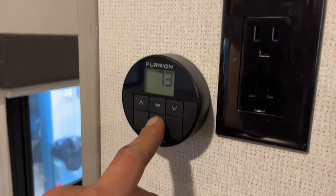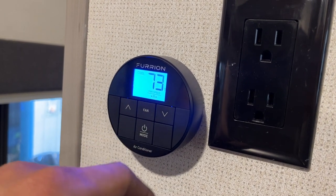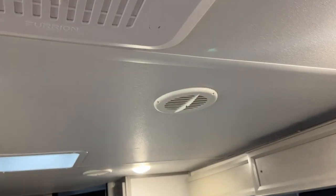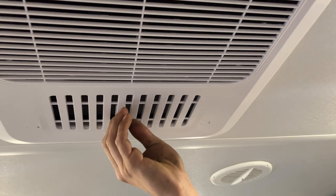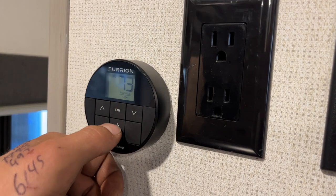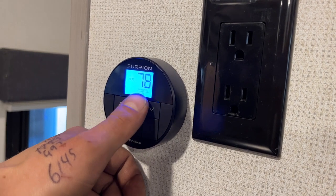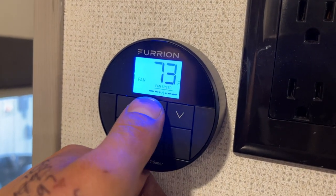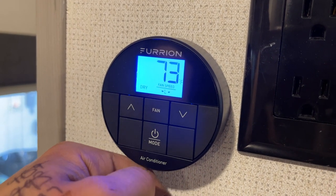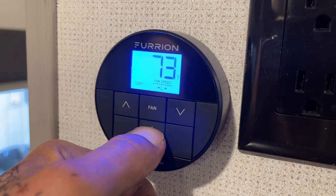On the left side you've got your thermostat — the power button turns it on. Cool mode first turns on the air conditioner; select your fan speed — low, high, or auto — and use the arrows for temperature selection. With the air conditioner going, you have two options: keep this louver closed to use all of your ceiling ducting to move air, or open it up to dump all the air into the living room. When you first get to your campsite, open it to cool off the air as quickly as possible, then close it to start moving air throughout. Hit mode after cool to come down into heat — select your temperature with the arrows; there's no fan speed in heat, it just moves air through all the portals throughout the unit. Mode again after heat comes down into fan — select high or low fan to just move some air around. After fan it comes down into dry — it runs the compressor with a low fan to get rid of humidity. To turn it off, press and hold the power button.